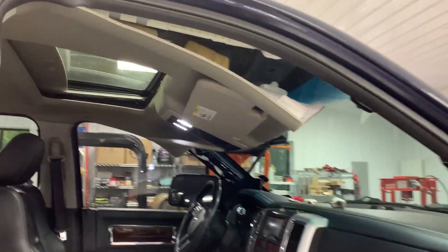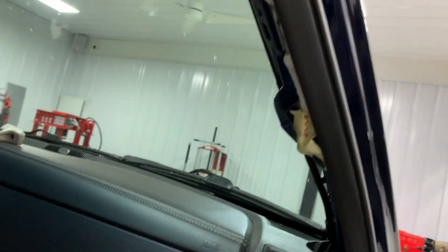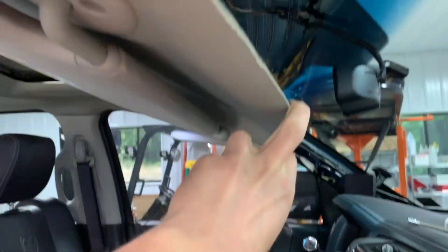I gotta say these headliners drop a lot easier in these trucks than I thought they would. The A-pillar filler and those handles come out, and then after taking out all the hardware that holds the sun visors up into place, this whole thing just drops down. Usually you have to take all this stuff apart but I didn't have to, so we kind of cheat it and pull it down just a little bit. It does stress that area right there, but as soon as you straighten it up it all just disappears once you push it up and in. Shouldn't be a problem — gives us enough access.